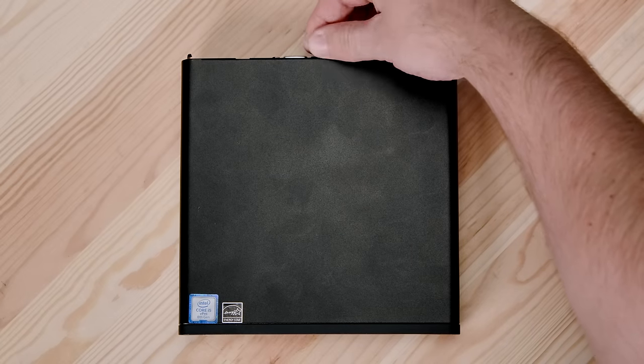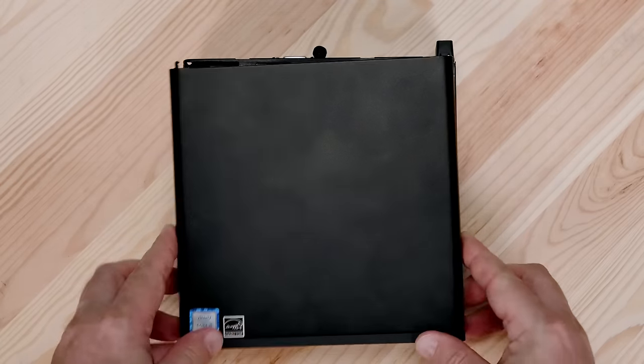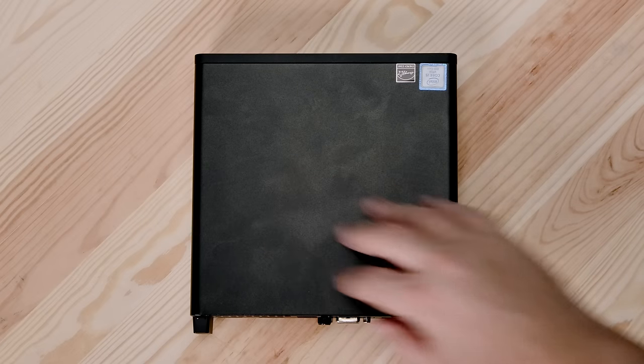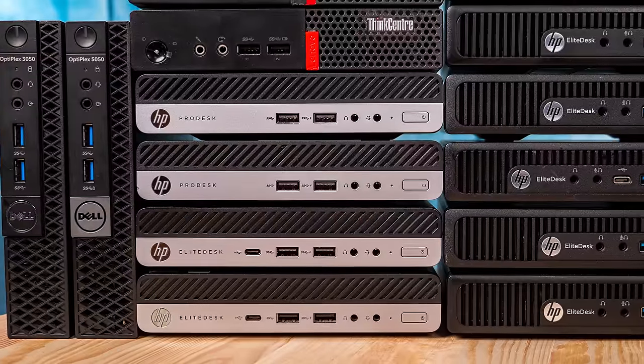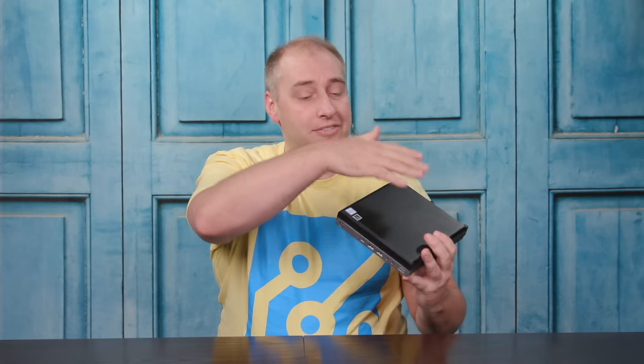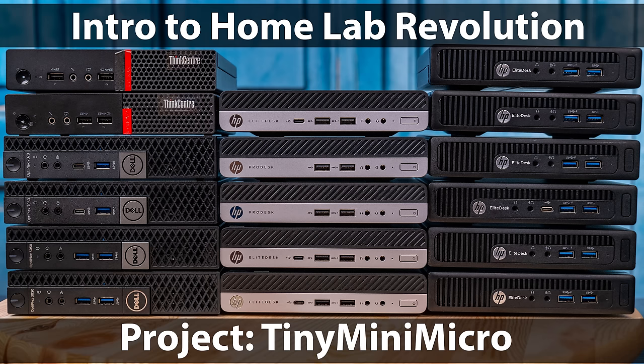We're actually going to look at the 35-watt version of this, not the higher 65-watt and higher versions. That's actually kind of a big deal. The fact that this is a 35-watt unit not only means that it uses less power, but it also has an impact on the physical system design. You've probably already seen the big difference, which is this has a flat top for Project Tiny Mini Micro. We don't want a perforated top drawing or pushing airflow out of the top, because when you stack these things up one on top of another for a cluster, you don't get the airflow — these units with a solid top are using horizontal airflow, and that's a much better design for a Project Tiny Mini Micro cluster.